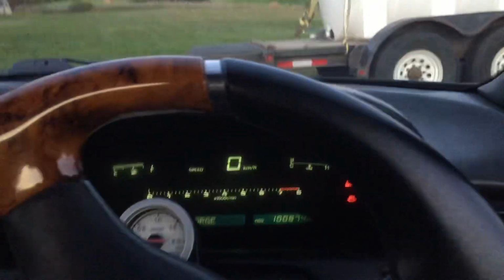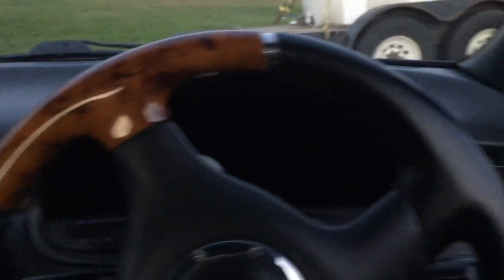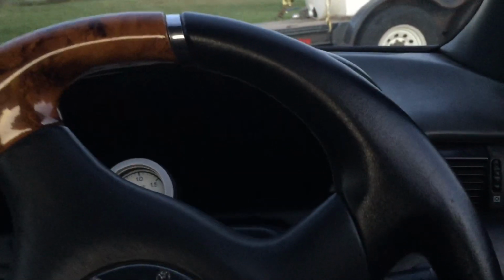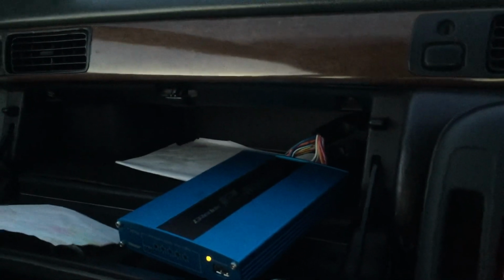And you know what? The car's running good now, but I ended up replacing the other 2 capacitors, which were still in good condition, but the kit that I got from Blender are higher voltage, so I was recommended by my friend who does circuit boards to replace them all, and I did. After I replaced the first 3, I put the ECU back in the car just to see if it'd work. This car came from Japan with the Greddy E-Manage. It's actually a pretty dynamite little system.